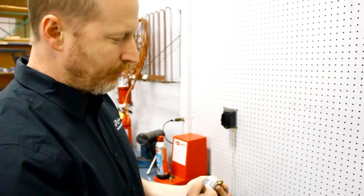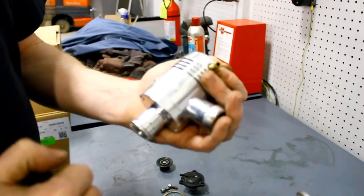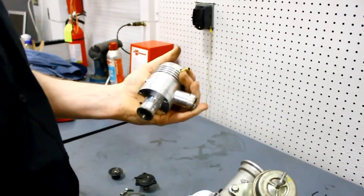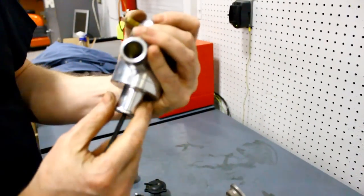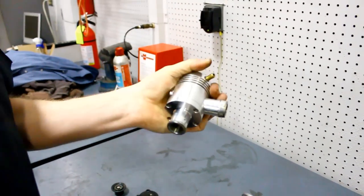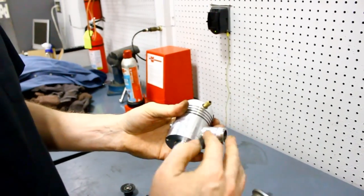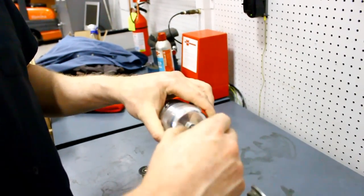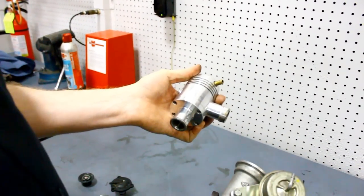This is our HD diverter valve — a full piston style. It does have a bypass window for those who choose to use it. This is a much stronger unit; I can't even open it using just my finger. It's a piston style that opens on the side, which is a much more efficient design for flow and stability. If you want to adjust the tension because you're not getting the boost stability you were targeting, it is adjustable: just loosen the lock nut, run the stud in or out, and tighten the lock nut back down to adjust the tension on the piston.